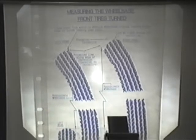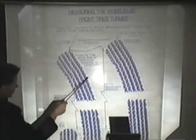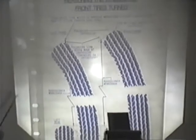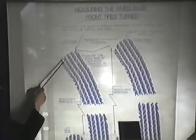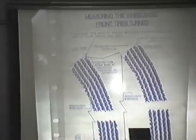Now, for the track width, we can measure center here to center there and get a rear track width. For the front tires, we could measure where they stop. You cannot measure straight across here. We could measure straight across here. We could go back a ways and hold the tire and tape at right angles. But we cannot do that for the front tires when they're turned like that. They're coming in at an arc, because the tracks they leave are actually closer together than the actual track width. When the tires turn, the tracks they leave become closer together than when they're straight.